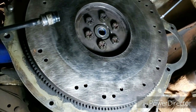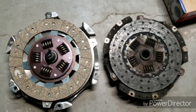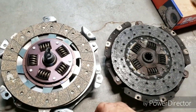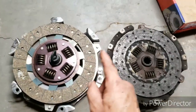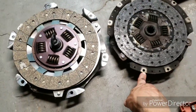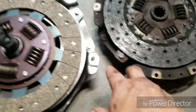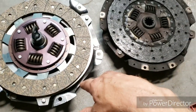A little speed bump unfortunately — let's get the clutches side by side. Upgrading to the heavy duty means we're going to have to get bigger bolts. The new one we got is larger, but there were multiple sets of bolt holes threaded on the flywheel. The problem is they're a lot larger than the ones that came in — you can tell by the size of the bolt hole. We just gotta get the bolts and hopefully it'll still fit inside the bell housing.